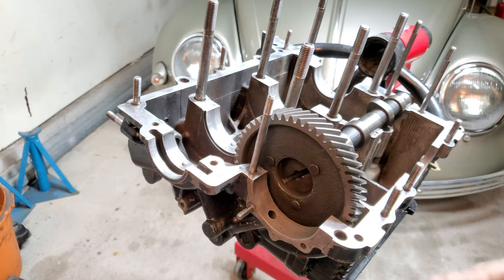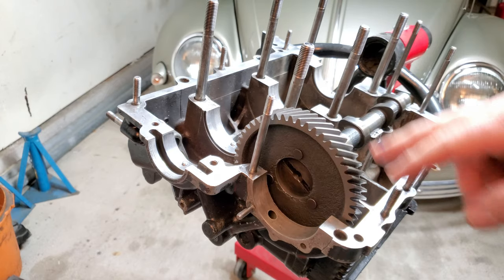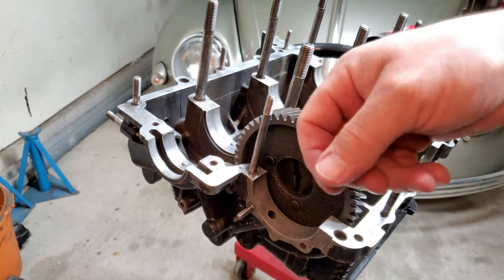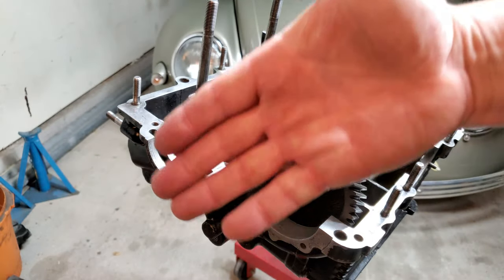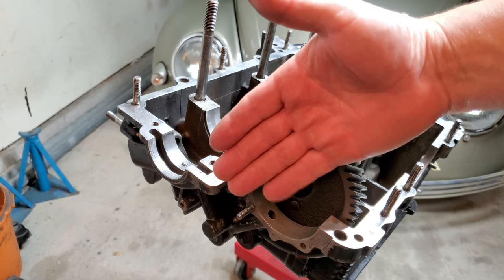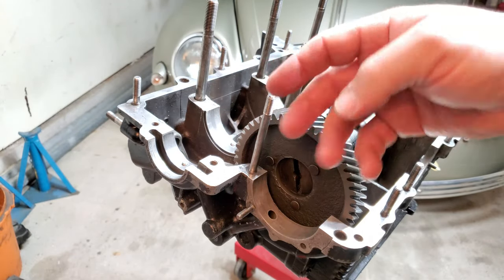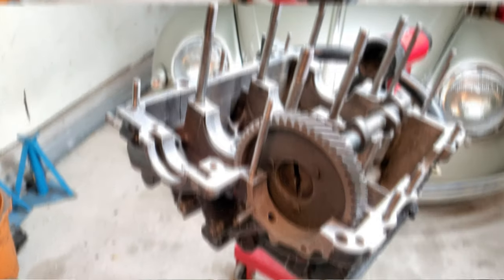We'll take a little bit of material off of the bearings and I'll be right back and show you guys what happens. Actually, I'll show you what I have to do to take the material off the bearings. It's best to use a flat piece of glass and an aggressive 400 grit sandpaper, but I don't have that. I have a piece of metal that I'm going to use instead of glass. Over at the bench, I'll show you guys what I'm talking about.